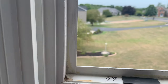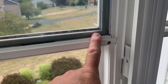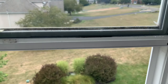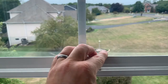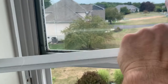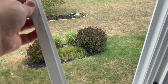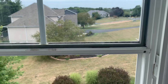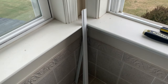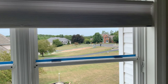We have it all cleaned up, now it's ready for the new foam strip. This window I'm taking out as well, so I got the four strips taken out. Sometimes this bottom one is very hard to get out and you really have to mar it up. When they send you the new panes, they send you new ones of these strips also, so I'll just put the new one they gave me on that bottom one, and the other three came out pretty easy so I'll reuse those.